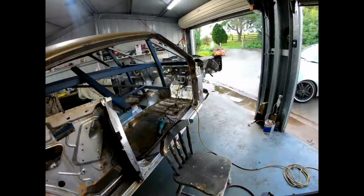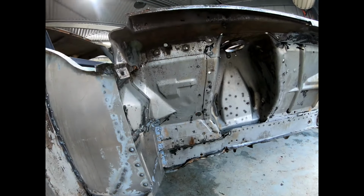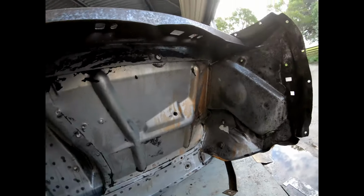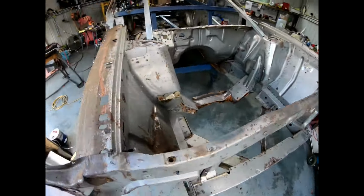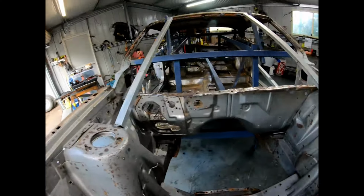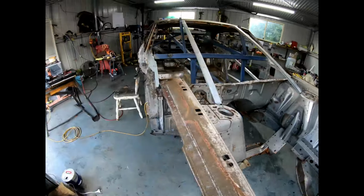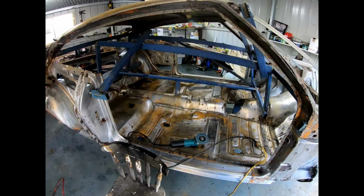under the guard here was a lot of work too. The underbody sealant, no matter how much paint stripper you put on, only comes off in layers. But the engine bay is pretty good. That was pretty easy actually. So I'll dress back these welds, followed by the epoxy hopefully soon.